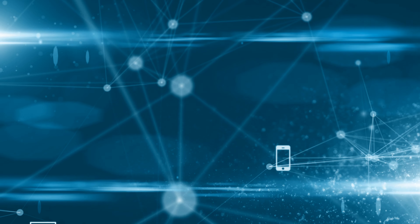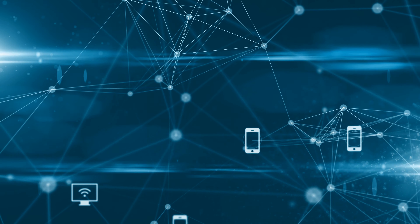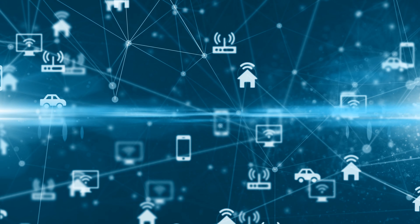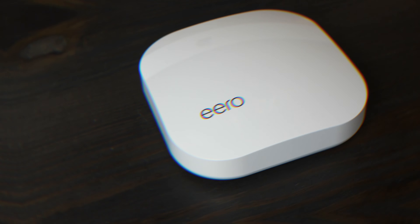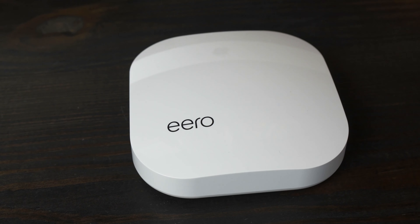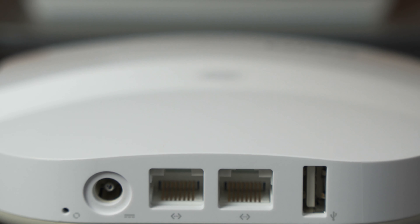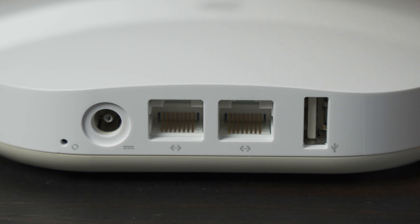Put all of your home computers, smartphones, and other things onto the main Wi-Fi network, and then put all of your IoT devices on a second Wi-Fi router running a completely separate gateway. This will make it impossible for any IoT device to see your home PC, Mac, or smartphone. Another option that many routers include is a guest network. For instance, I use the Eero Mesh Wi-Fi system, which lets me run a completely separate guest network that isolates devices from seeing not only my main Wi-Fi devices, but from seeing any other devices on the guest network itself — it's like putting a tiny firewall around every single device.